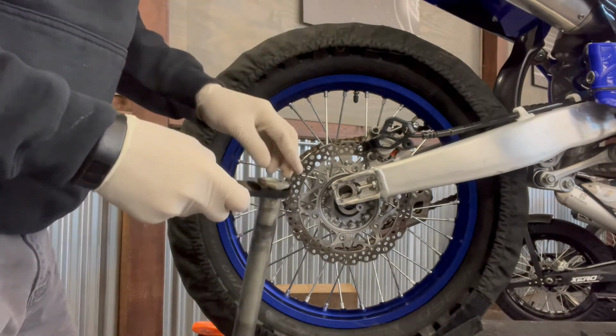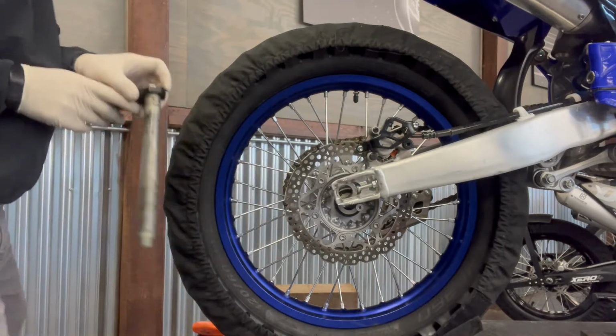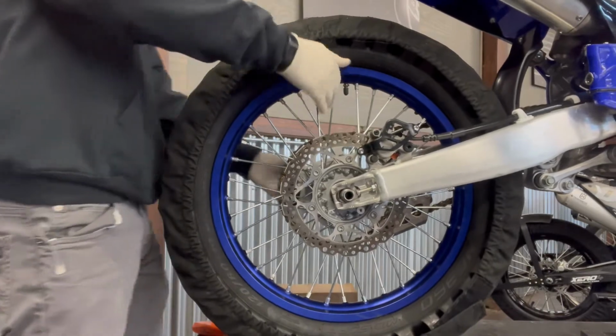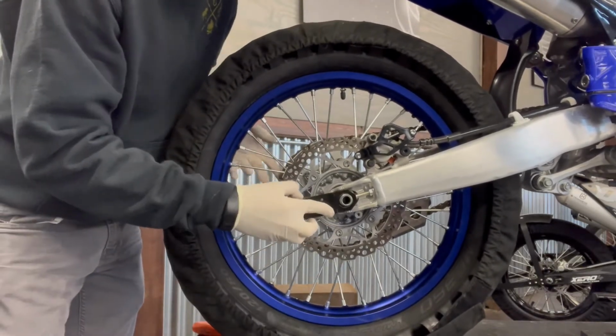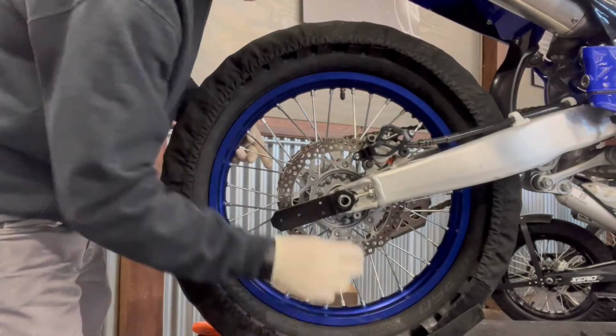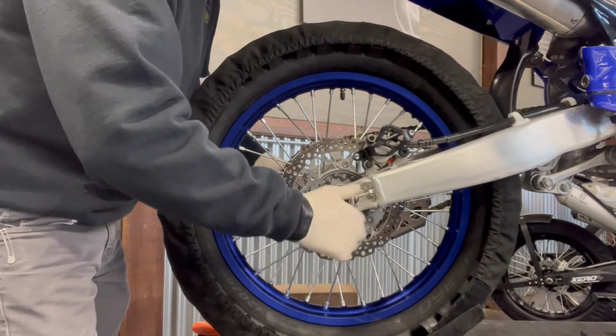The XeroFour axle blocks, install stock axle, slide it through and reinstall. Don't forget, look up in your manual what the manufacturer torque specs are for the axle nut and torque it down accordingly.